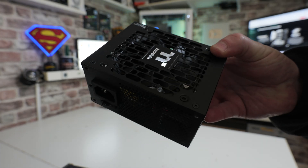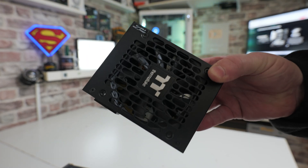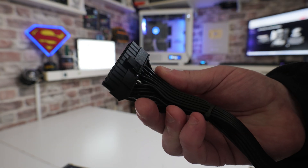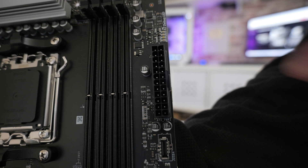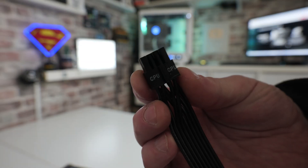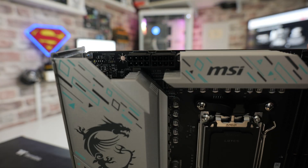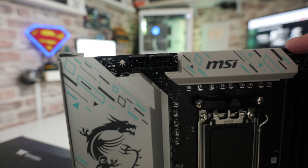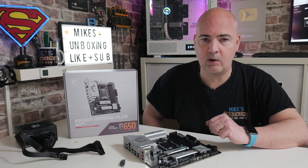You're also going to need a power supply. We've got an ATX power supply here. You only need to connect two connections to your motherboard for a bare board flash: the main 24-pin power connector, located on the far side of the board near the DDR RAM slots, and the 8-pin EPS connection in the top left-hand corner. This specific board has two of those connections. You can use either, and if you've got an older power supply with only a 4-pin connector, in a pinch that will still fit and work.